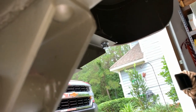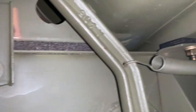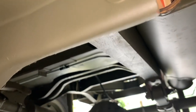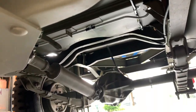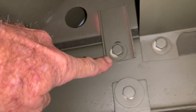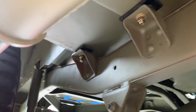The space is fine because I haven't tightened anything down yet. As I tighten the things down from the front to the back, it will draw this all together and it fits perfectly. Let's take a look front to back here from the driver's side — everything's tightened up and fits nicely. One bolt that I forgot to show you, and those are the last ones I installed after tightening all the bolts down, is this one right here in the front gusset or support. It's size 3/8-24 by 3/4 inch, and I did install those last. Let's take a look down the passenger side of the frame where we've got everything mounted up and tightened up.